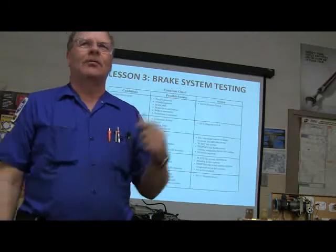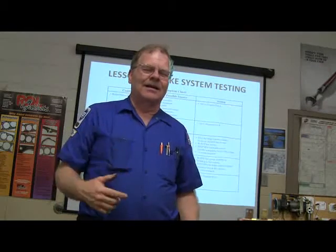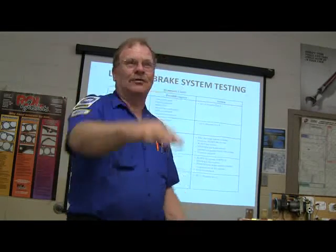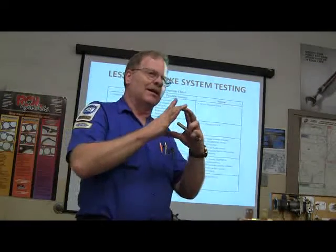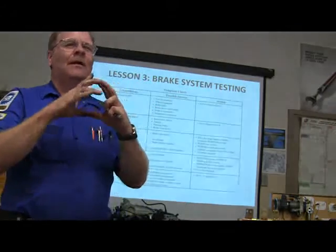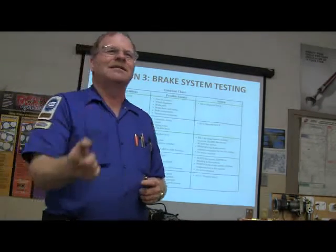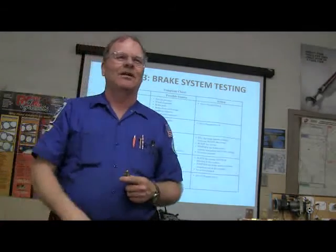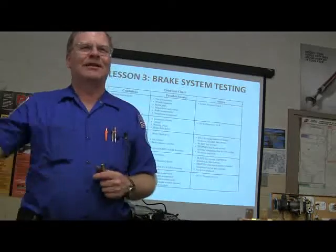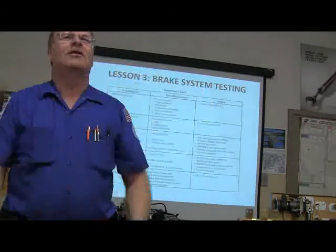There was a Thunderbird that went through, this one guy was riding, and whenever he drove it, he hit the brake, and it went through a red light. Because the ABS system was falsely activating because the little sensor ring came loose from the wheel and the wheel was still rolling, but the sensor ring stopped and the wheel speed sensor stopped delivering a speed signal, and the ABS stopped the fluid going to that wheel. He was standing on the brake and it was bouncing against his foot and went right on through the intersection. Wow.